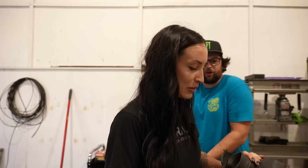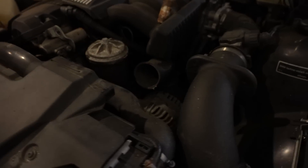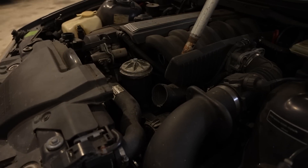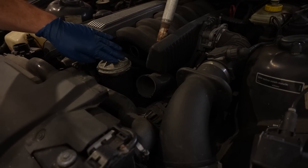That was crusty. How are you going to keep your alternator cool now? It's going to overheat the alternator. Don't worry - that clutch fan is going to throw enough air back there. They do that because of the clutch fan - it blows all the heat right onto the alternator. So they have a cool air scoop that goes right here to keep it cool. Later BMWs put the alternator bolted to the block and had coolant running through it - a passage of coolant coming out of the block to cool your alternator. That is some German engineering. It's so stupid - it's not even anywhere near the header.